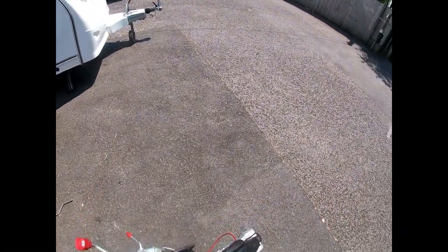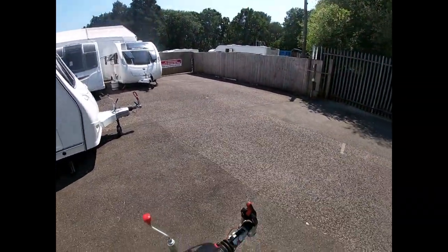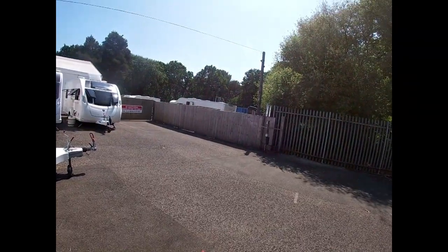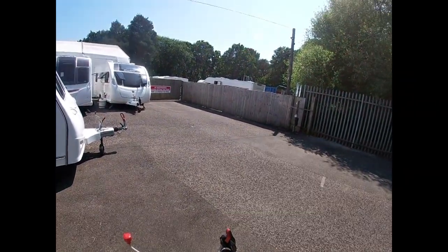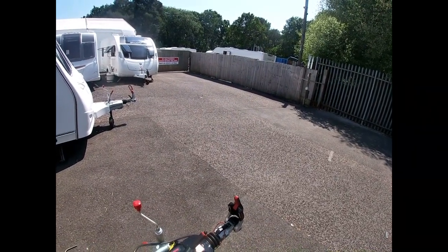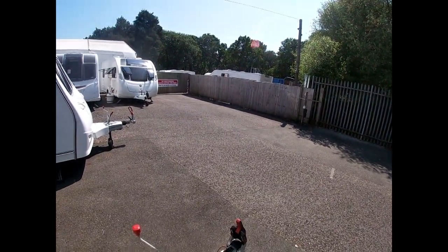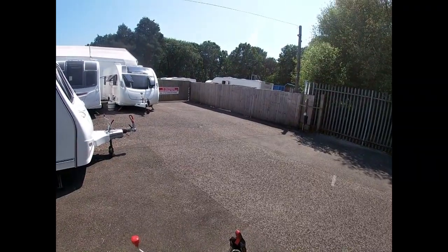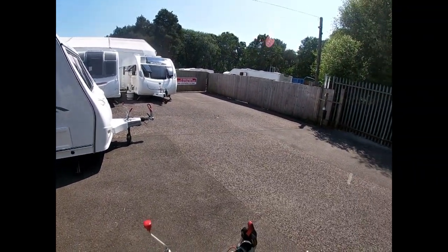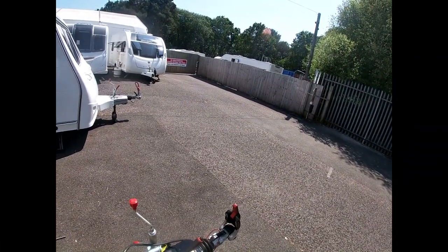I then come along and push down on what is known as the stabilizing head. Now inside there, there's four plastic thrust pads. Those four plastic thrust pads minimize the sway from left to right and the pitch and roll from up and down. And they do that by locking on to a nice, clean, shiny tow ball of your vehicle, okay? Because they're plastic thrust pads that go in the end of there, and they just sit inside and they will lock down. So it's of paramount importance before you come to collect your van that you make sure that it's all clean and shiny, degreased, so that it operates in its full correct manner.